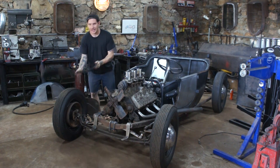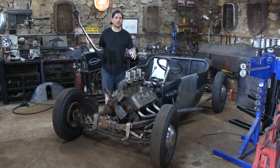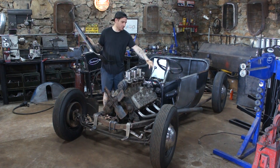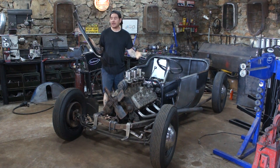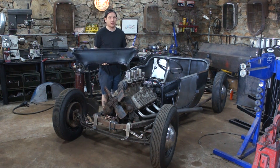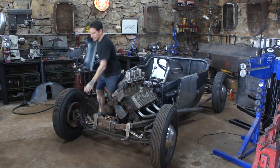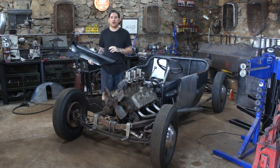The top of the cowl here, we never welded it in because we still need to do some more work. I've already begun just dusting some paint on some of the bracing and the hoops behind the dash for supports because they're going to be hidden. Now what I need to do is do a little bit more repair. There's a little spot here that I need to cut out and weld a little patch in. We started rust proofing everything with some Eastwood rust encapsulator. Then we need to put the cowl top on, start spot welding it, and then eventually get the firewall in and spot welding, and we can start working our way around the car.